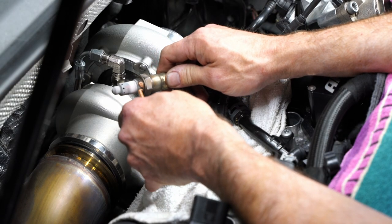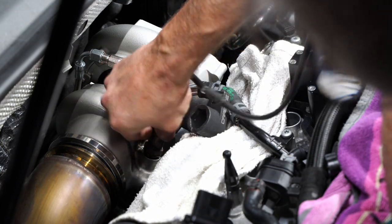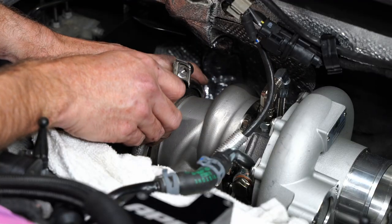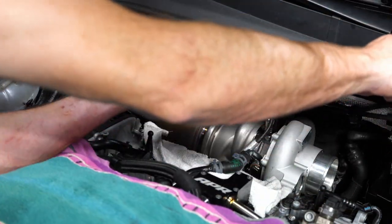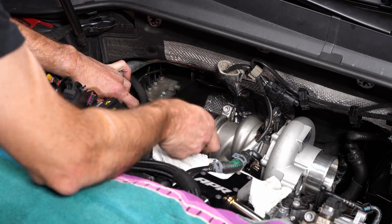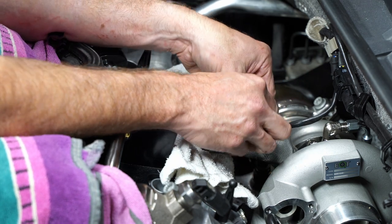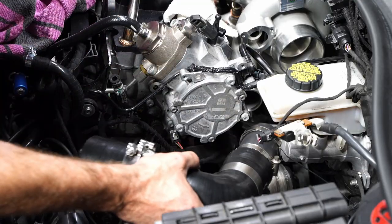Put in the O2 sensor. I see some people say to pre-fit this before you put the turbo in, but I had plenty of room to do it with the turbo in, so your mileage may vary. Now I'm putting the V-band clamp on to connect my downpipe to the turbo, torquing that down, and then also tightening down the lower downpipe bracket because I had that loose so the whole downpipe could rotate. Putting on some heat shields - one important note, you may want to save this until after you're done with leak testing because you'll end up pulling them off anyway if you have any leaks.